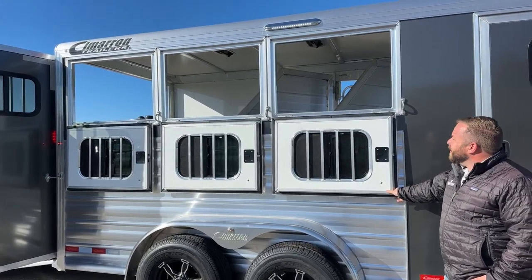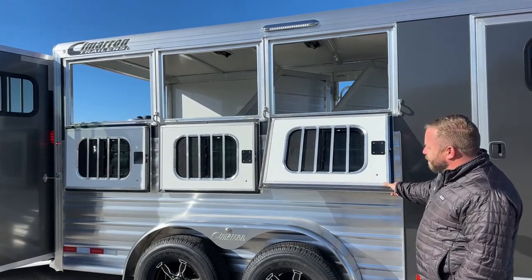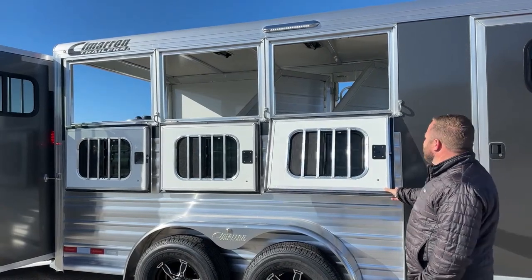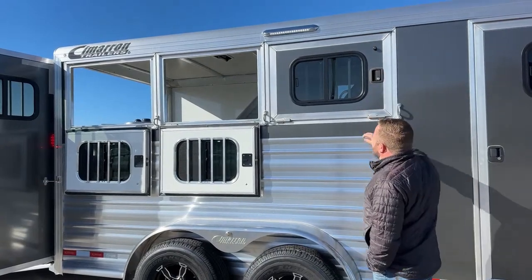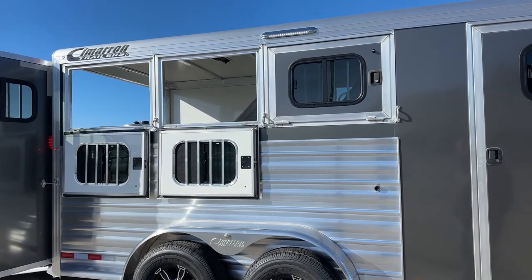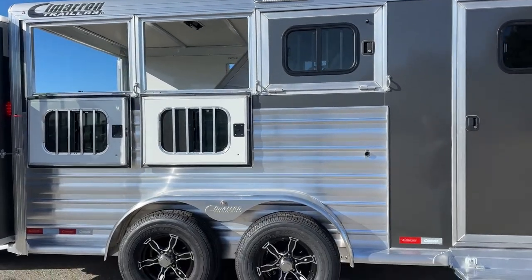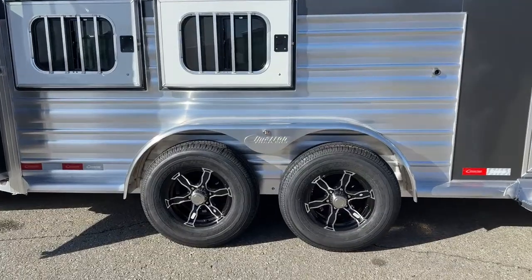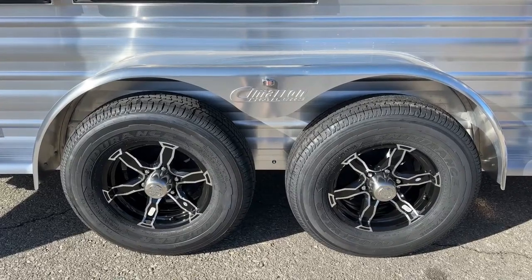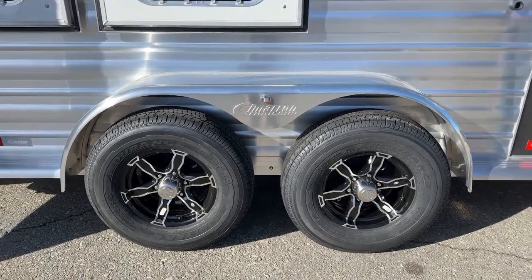They are serious — you can see the amount of open space you've got. They do have bus windows in them, so if it's wintertime and you want to control the heat a little more they're easily slammed shut. Very, very solid unit. Moving down, we're riding on Goodyear tires — top notch, 10-ply — on 5,200-pound Dexter torsion axles with electric brakes.